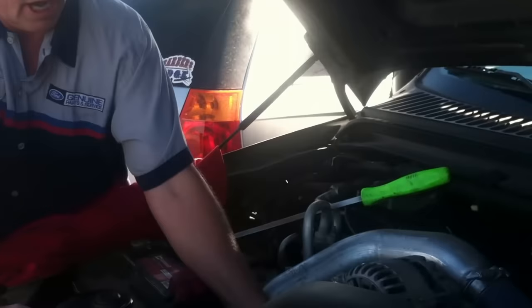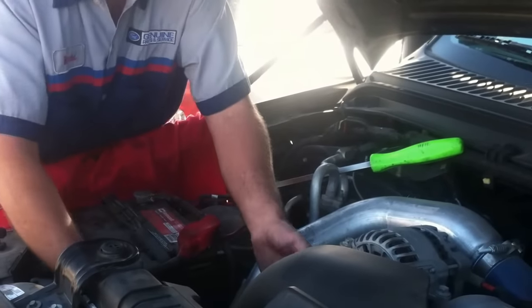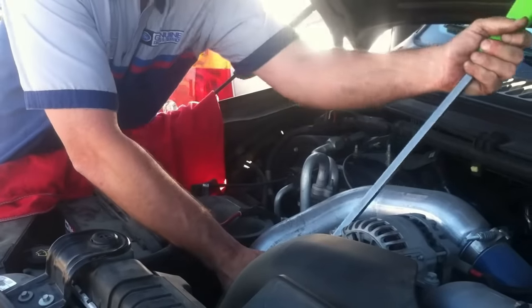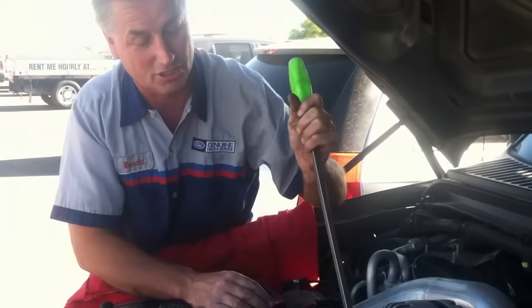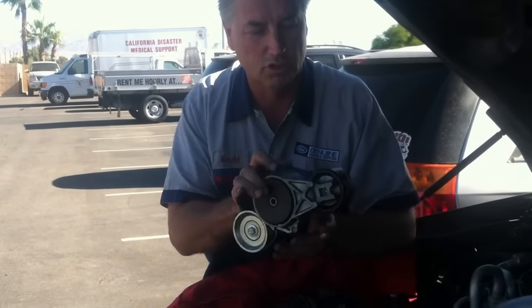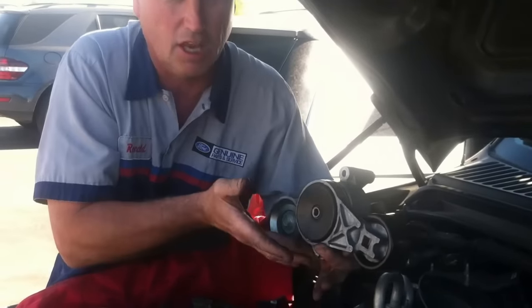Sometimes if you're not able to pull up on it, if you can get two hands on it, you can get somebody to reach underneath there and help you out. Or — this isn't always safe because you're pushing against yourself — you can take a pry bar and push on it to reach down and lock it, but just be warned. Anyhow, that's my trick on doing the belt or the alternator or whatever else is easy on the truck, as long as the belt's still on so you can pry up on it. If not, you have to use your half-inch drive here on the smooth side pulley. Use your half-inch and then you can pull up on it and same thing, lock the tab. Thank you.